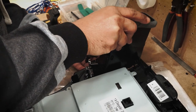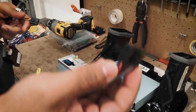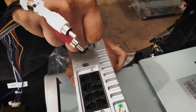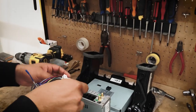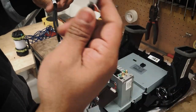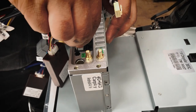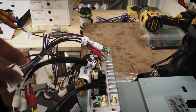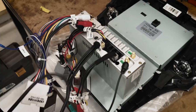We're going to put the power cables on now. This plug is a bit rectangular — here's the main power plug; just push it in until you feel a click. Next you have the reverse camera plug, which leads into that spot here. Then you have two RCAs — in case you're using an aftermarket amp, this is what you need to connect it. This is the radio antenna — you plug this into the factory connector. And we also have our two USBs.